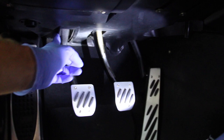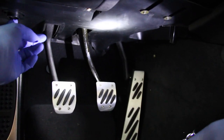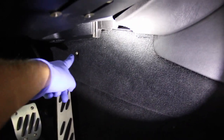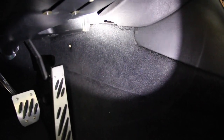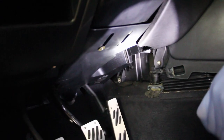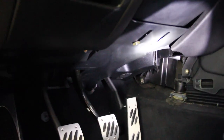Next we need to remove the driver's pedal box ceiling — there's a big piece of plastic up here. To do that, we first remove the transmission tunnel piece of trim; it has one exposed brass Phillips screw. Pull that out and the whole trim slides back towards the rear of the vehicle two or three inches and comes out easily. Moving on to removing the pedal box ceiling: there are two small allen heads here for the Euro steering column setup. On a strict US-spec car it'll be more of those gold brass Phillips screws up at the top.